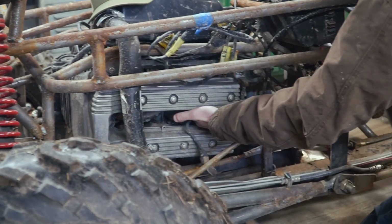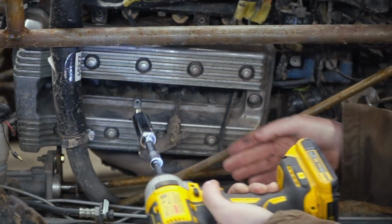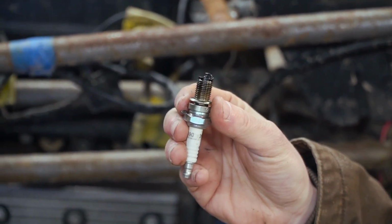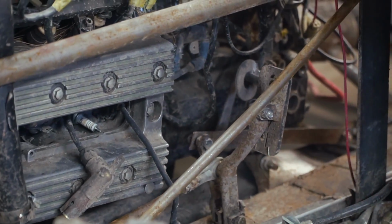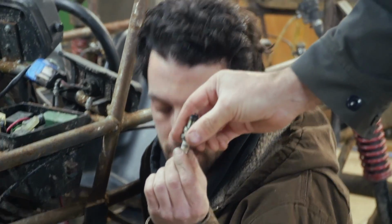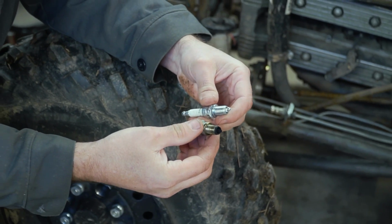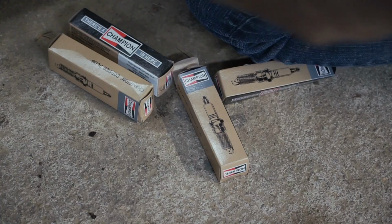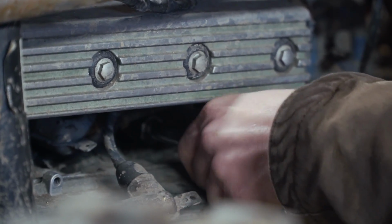All right, spark plug is not even tight. Oh, that's interesting. Not even tight. There's one. That looks terrible. Oh, that. I'm gonna say that one was foul. Well. Yeah, definitely. All right, got one. Another one. Cool. And this one was probably firing. It looks very rich, right? Yeah, that one looks like it's firing. This one looks a little bit hotter. The one we're putting in, RA6HC. I'm going to go ahead and do just two at a time so I don't run into mismatching. That's fine.